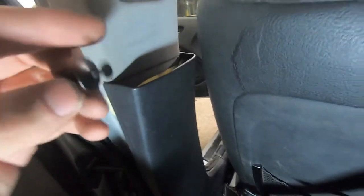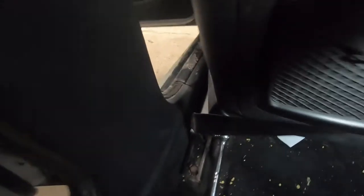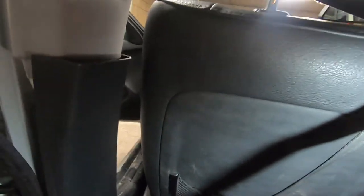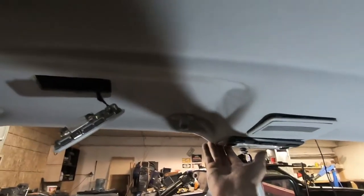I've removed both those clips — the ones where you pull out the center and then the bottom piece. The trim piece will now just fall from the ceiling; it's basically being held by the seatbelt. You need to undo the bottom mounting bolt to your seatbelt. Pull your driver's seat all the way forward and up to access it. Down here, the seatbelt bolts to the rail — it's a 16mm. Undo that, feed the seatbelt back through the hole, pull it all the way through, and the trim will now be free.